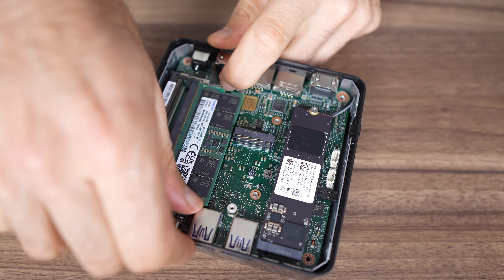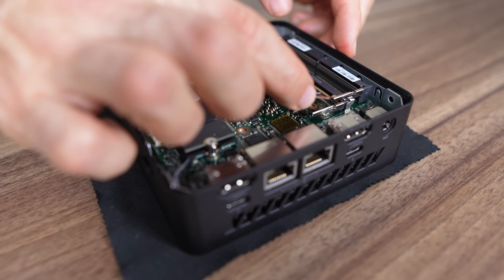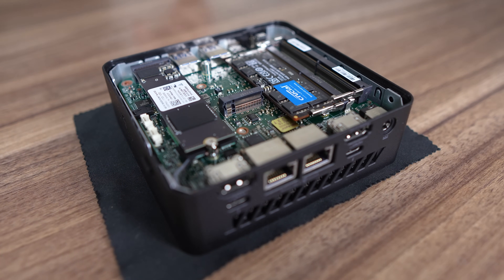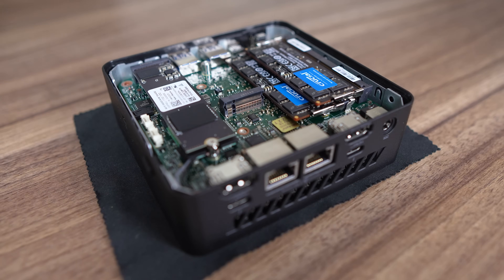If you're adding parts to a barebones mini PC, you should always use two sticks of RAM, as just one reduces both CPU and GPU performance. Since MSI sells the Qubi as a barebones, I'm going to add two sticks for this review — that's the configuration I would have made if I bought it. There are also additional power modes to test, so benchmarking all different configurations wasn't feasible.